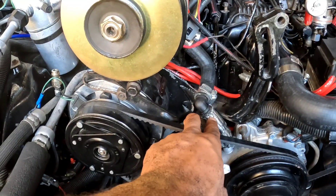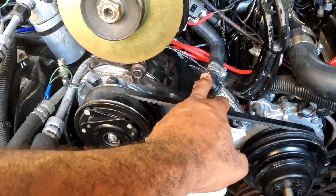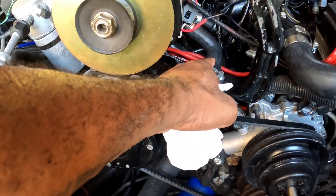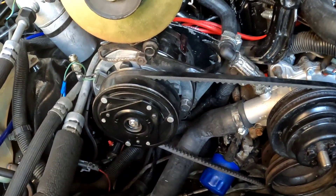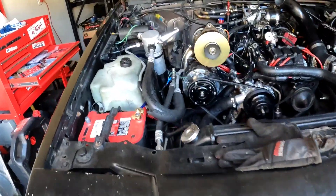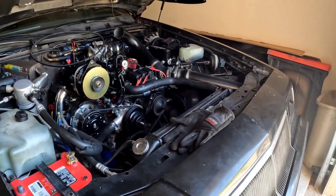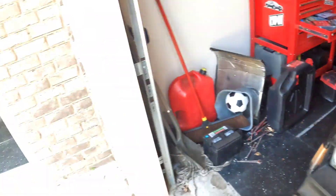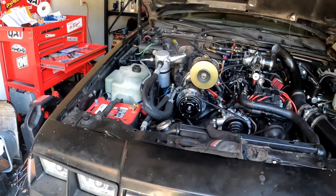On this water line, I didn't cut it short enough, so I need to bring it down another half inch to drop it a little more. I got another pipe to go on it so it fits more snug, then I can put the alternator back down and make the appropriate belt adjustments - it was squealing last time. I had the car sitting for a while because I was working on the Impala, so now I'm putting everything back together and getting it ready to go to the transmission shop.